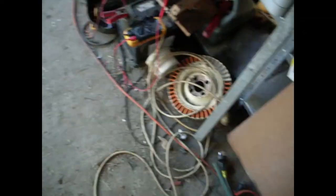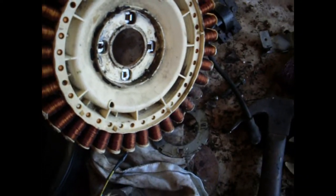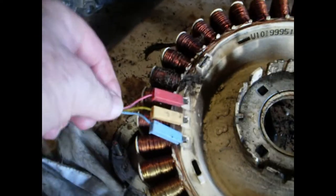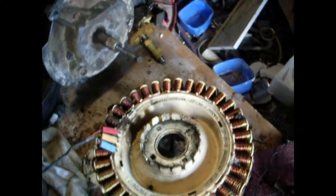From there we've got electrics. There's the coils there, but that's an old one. I don't know where I put the new one — they're here somewhere. Somewhere put away precisely where you know where to find it, but I can't find it. There it is under there — I knew I put it somewhere where I could find it. Here we go, and this will be the electronics for it. It will sit on a flange outside. This coil set will put out a three-phase AC voltage. We'll run it through a rectifier and get it to DC.